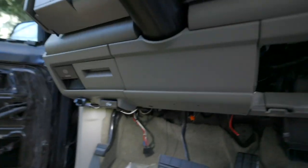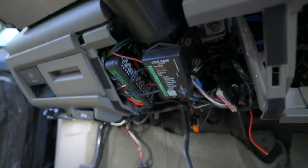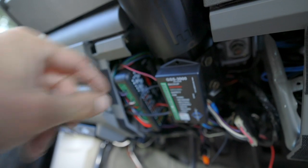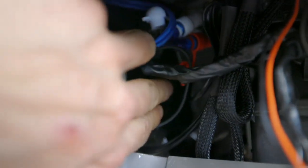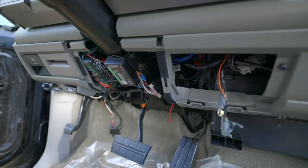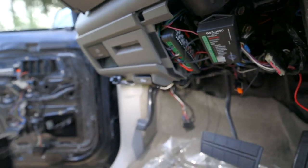It's actually the end of the next day. I've been taking my time with the wiring — I hate it, but it's going to be worth it in the end. Let me show you where I ended up putting the control box and the Retro Sound radio. I used some velcro for the speed access panel and it works out pretty good. I mounted the control box here — this one is for the gear selector, this one is for the Dakota Digital gauges, attached with velcro. The radio is velcroed to the steering column support. It was really difficult to find a way to fasten that, and that inspired me to make the access panel.